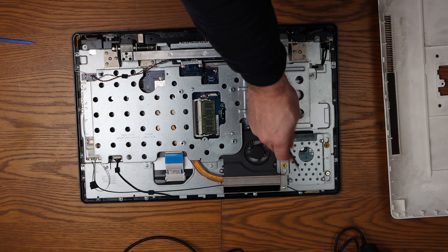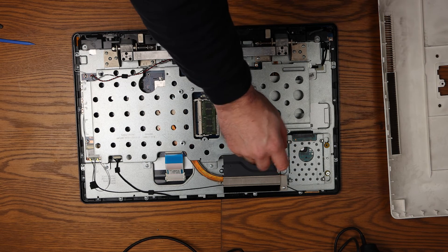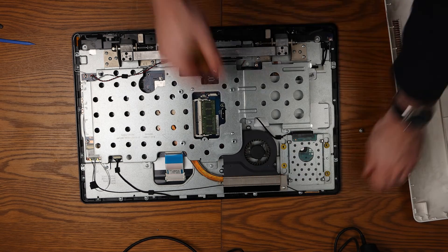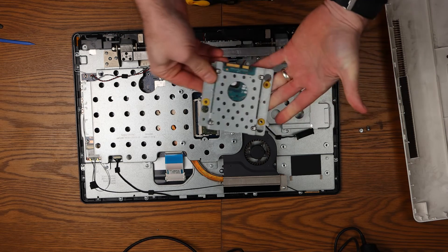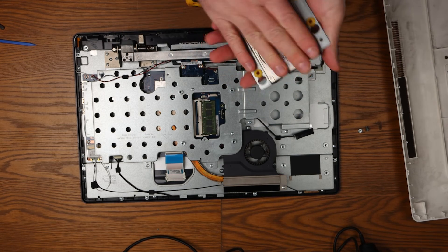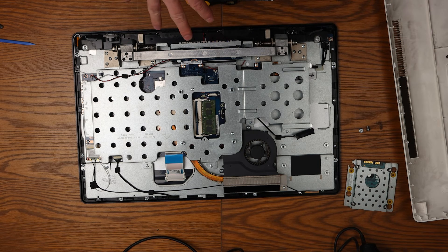The bit we're interested in is the hard drive up here — really, really straightforward to free. It's just two screws and a cable and that will free the whole hard drive cage. There's our hard drive, and this is already an 80 gig disc. To fit the new hard drive, a couple of screws on either side, replace the disc, the whole thing slots back in and we're good. I'm going to give this a quick clean off camera, sort the fan out, clean out the back because it's a bit grubby, and then get that hard drive replaced.